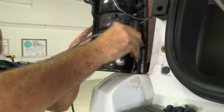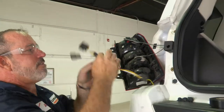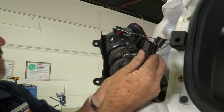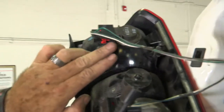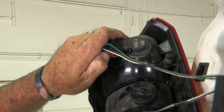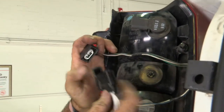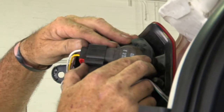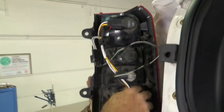And there's our connectors right there, and there's our ground wire. We'll go ahead and take our pull wire off and just pull it straight out. These are our two connectors. I'm going to go right in between our top tail light connector here. To remove this, we're going to pull back on the red clip to unclip it, press the button, and then just pull straight back and it'll come right out, just like that. Then we'll get our mating connectors, plug it in, clip, and lock it in. Clip in and just push the red button to lock it in. That's it for the driver's side connectors.